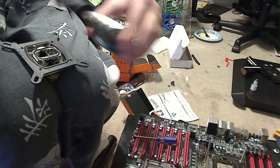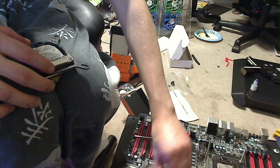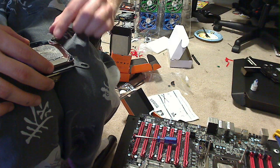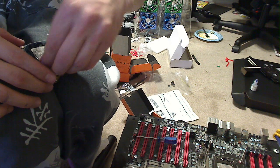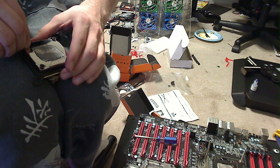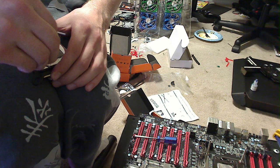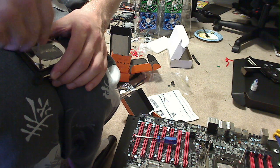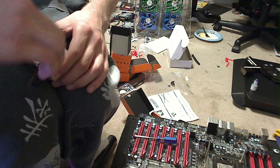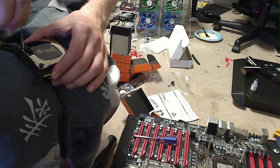One of the most crucial things after changing out the plates is to ensure it's not leaking. A leak from the inside will spell disaster for your chip — and in my case, that's a $1,000 chip times two, not something I want to deal with. So I'm going to tighten these down and then get the other one done.